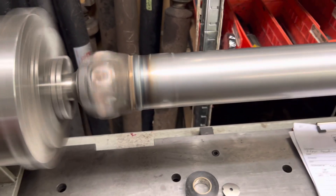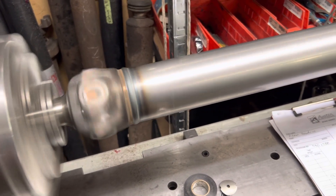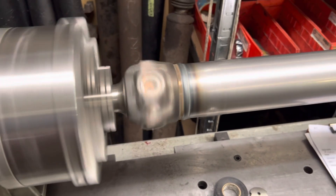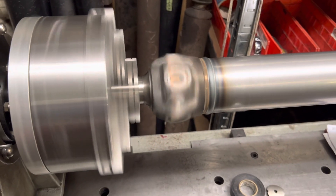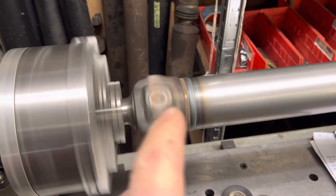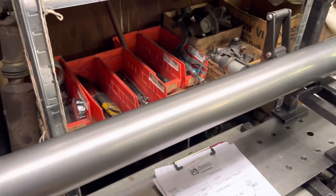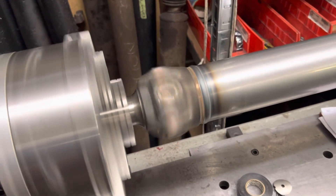It was one of those things where they didn't give me the really warm fuzzy feeling. What I'm after at the end of the day is to give somebody back something that works really, really well, so we just skipped over those. This is now brand new from Vendette: a PTI slip yoke for a Turbo 350 or 700R style transmission spline and seal diameter, a pair of 1310 Spicer snap tights, 3-inch .083 tubing. His required length was 53 and 7/16 inches center to center. It's got special snap tights in it — all of it is new and all of it is good.